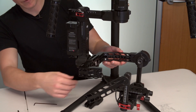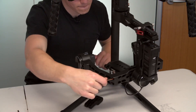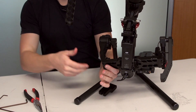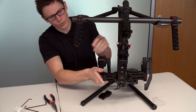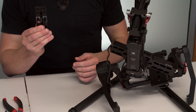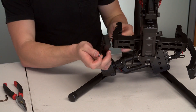Now that the first side is on with a couple of screws back in, we'll get the second side off. Once all the screws are out, this part is just a little bit tedious — be careful, you don't want to drop your assembly. Work it out nice and easy and set it down. This is the skinny oval, so make sure you have it around the right way. Be careful not to put too much pressure on any of the cables while they're free.